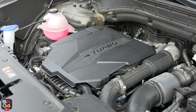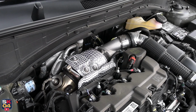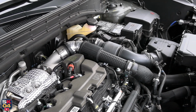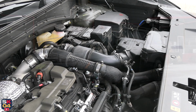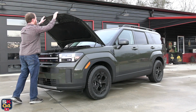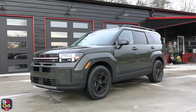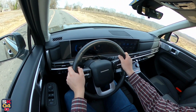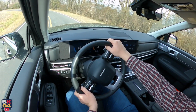Direct injection benefits from greater oxygen density in the combustion chamber combined with increased atomization of the intake charge for maximum power and efficiency, especially at mid to high engine speeds. Multi-port injection helps to reduce emissions at lower RPMs and lower engine torque loads. Together, the two injection systems combine to offer good power efficiency and low emissions throughout the engine's full range of operating conditions. The compression ratio is 10.5 to 1.